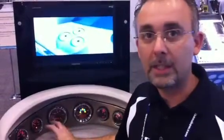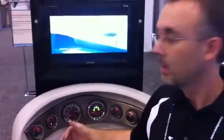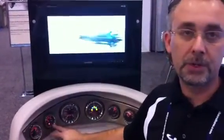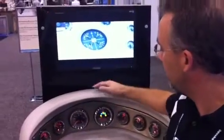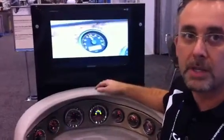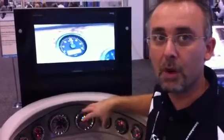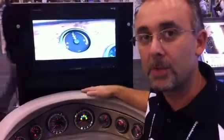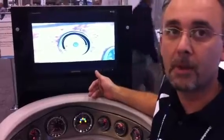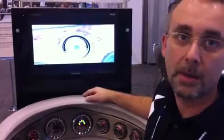We move forward with LED illumination — a traditional backlighting that we've always had, and now it's LED. Each gauge now features a built-in LED warning light, which is something unique to VDO as well. Another neat feature with our Viewline is removable bezels. There are nine different bezel combinations that you can choose from. These simply snap on from the front, or if you want to use no bezel, you can mount the gauges from behind the panel for a nice, smooth panel-like finish.